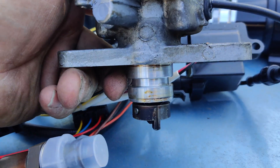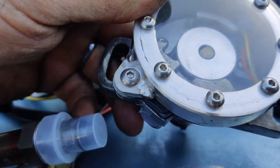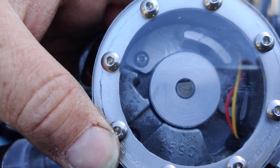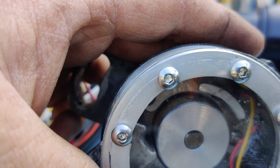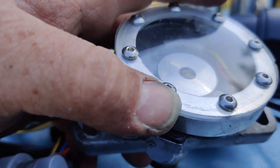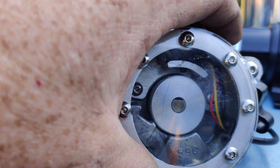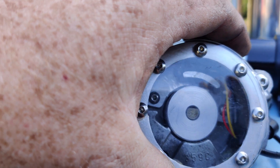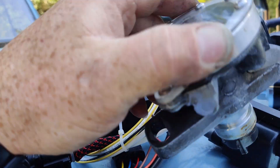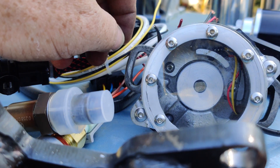One of the cam position sensors — this used to be the distributor for the stock engine, driven directly off the camshaft. What I did is I took the cap off, then machined a riser plate and machined down the shaft, cut a flat on it. That piece of aluminum in there has a single neodymium magnet on it. I'm not sure if the neodymium will hold up to the heat, but it's pretty removed from the engine so it should probably be okay. Inside where the wires are going, there's a hall effect sensor epoxied into that piece of aluminum. It's a plate in there so I can bolt it onto the engine and fine-tune it if needed, though I can also just adjust its position in the software. I put a plexiglass cover so you can see what's going on.